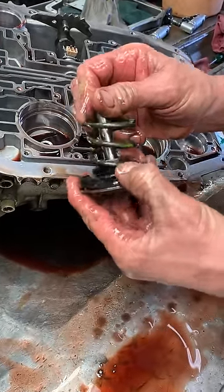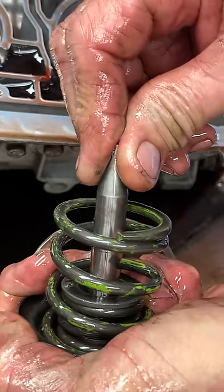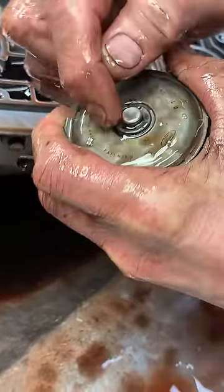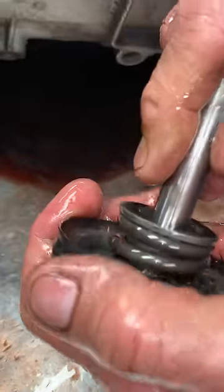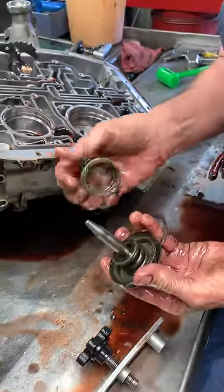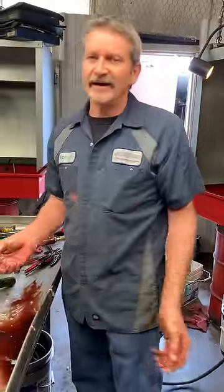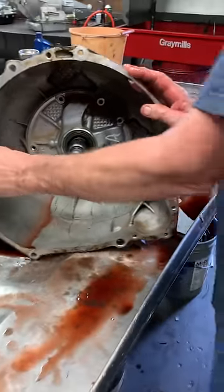It's still a bonded piston — check the rubber, make sure it's really soft. If not, get rid of it. These have a bad problem — see how that wobbles in the piston? This piston's worn plum out. These snap rings break too. The overhaul kit comes with a new snap ring, but not the piston — you have to ask for the piston separately. Even though the seal looks good, it's going to leak so badly around this pin and burn the overdrive band up because it just can't pressure up. You've got to check it in multiple places — being able to identify wear spots in a transmission is critical when you put them back together.